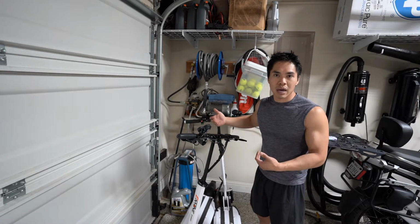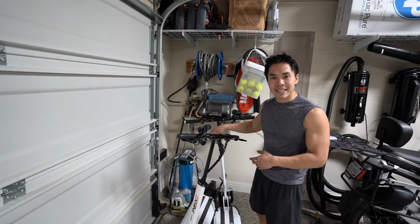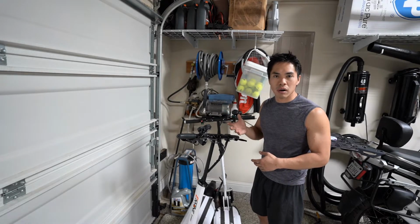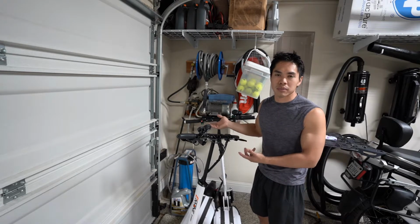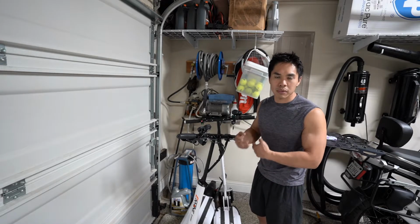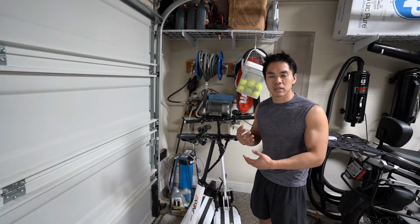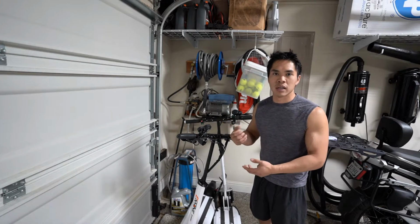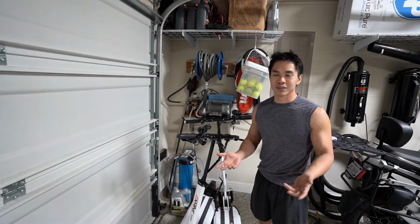That way, when your water... I live in Texas, so water dries really quickly in the summer. So when you attach that to your pressure washer, when the sun hits the car and the water dries out, it doesn't leave water spots. It's just a deionized water system that basically does a salt exchange. If there's chlorides and sodium in your water, it exchanges them out for an organic salt, like triethylamine or diethylamine, and once the sun evaporates it, there's nothing left because it's an organic salt.